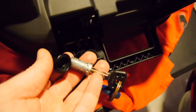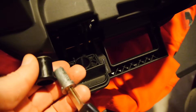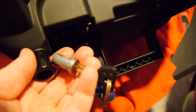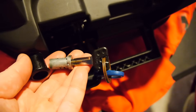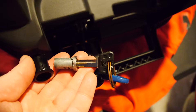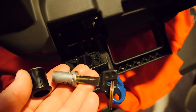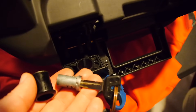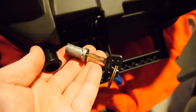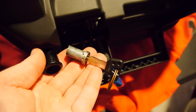Once you get all three of these areas perfectly clean and sprayed with dry lube, you can reassemble. Make sure to use blue Loctite where appropriate for your bike. Then you'll have a nice smooth key action everywhere on your bike. As long as you don't spray the wrong stuff on here or get your bike horribly dirty, you won't have to do this very often at all. Hope it helps somebody — see you next time.